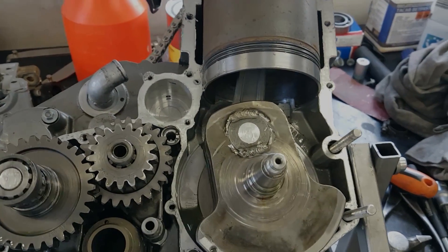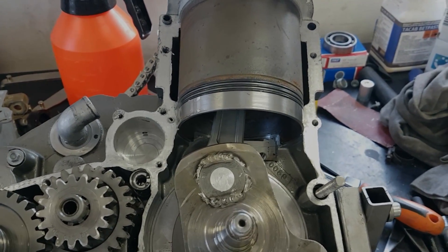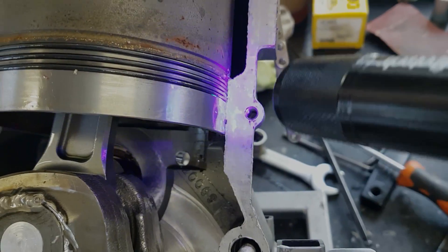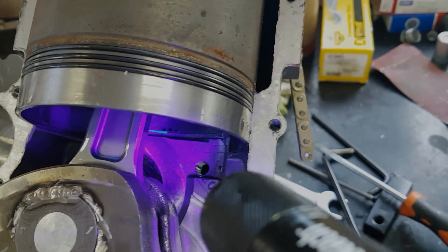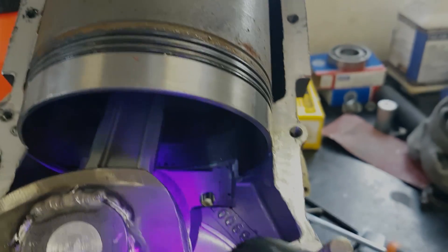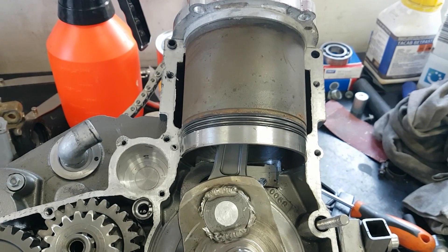It seems more obvious now that the leakage is not coming from the head gasket. There is leakage through the O-rings or the sealing surface — you can see water signs in the ceiling area and down at the bottom as well, so it's not coming from above. Inside there is no leakage, so there has not been a leakage on the upper side going past the piston. The O-rings and sealing surface between the two crankcase halves — more likely the leaking plate — are the culprit.